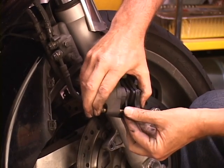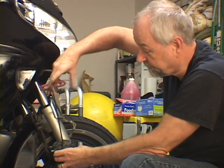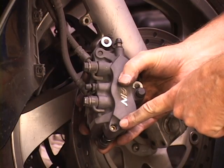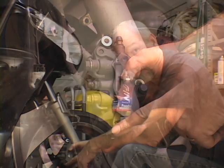Move your pin all the way in and then tighten it up. Note to self: if you tighten this pin too tight, the heat from the caliper will lock it in and you'll wind up stripping the head, having to either machine it out or replace the caliper. Save yourself some hassle.